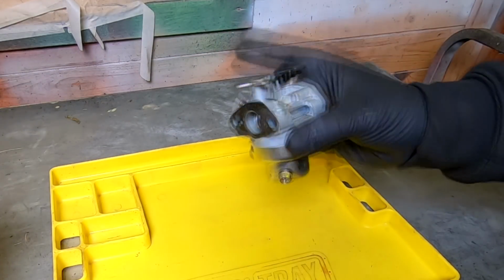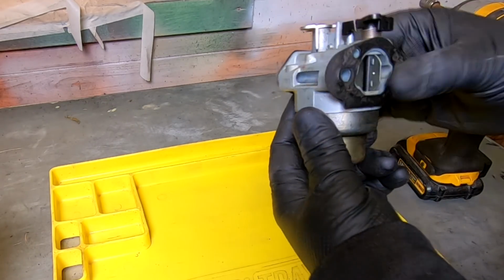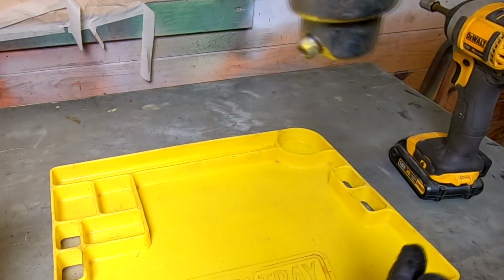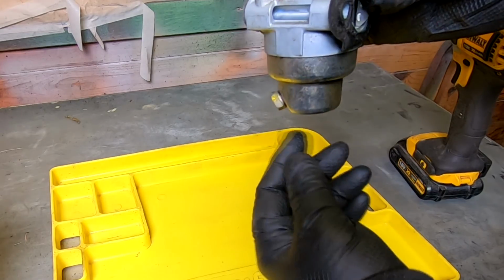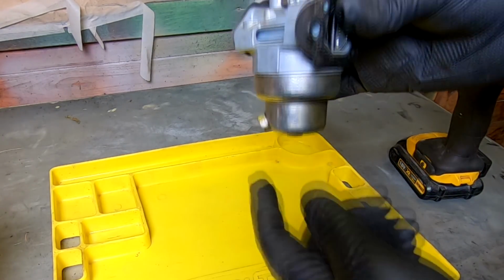Right, okay, here we go. And I am making note, folks, of the way that the float bowl come off. Someone's put it around the back there, which isn't normally a good idea. See, that's the way the carb goes on. So that's been put around the back. So I'll be bringing that round to either the side or the front so that if you need to drain your float bowl at any time, you've got decent access to it. Someone's actually had this off, I would imagine, and put it on the wrong way.